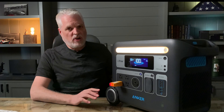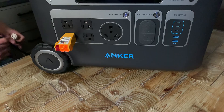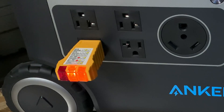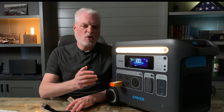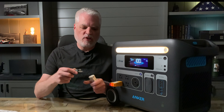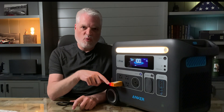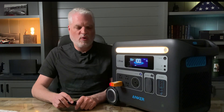This is a problem — this needs to be returned to Anker. This condition only appears if you're plugged into AC power. If I unplug this, the condition changes to two yellow lights. Looking at the label on the top of my tester, two yellow lights means it's correct. So whatever is causing this condition inside the Anker is only happening on pass-through power, not with the inverter. You've got to make sure that when you test, you have AC power connected. If you see that red light, that means you have an issue and the unit needs to be returned to Anker for replacement.